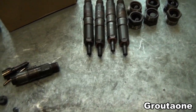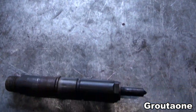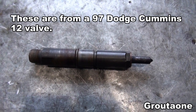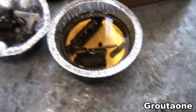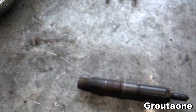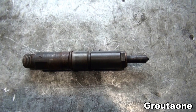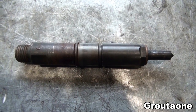I'm working at disassembling and cleaning these injectors. One of the things I don't know yet is what is the proper torque setting to tighten these two portions of the injector body together. Maybe once this is uploaded onto YouTube someone will see this and leave that proper information. So what I'm doing is using the torque wrench to test how much torque it takes to loosen it. I don't think the loosening torque and the tightening torque are the same, however with that information I can do more testing and figure out how much the tightening torque is.